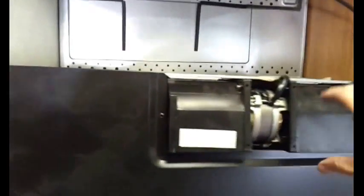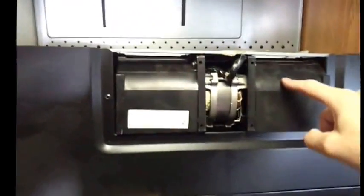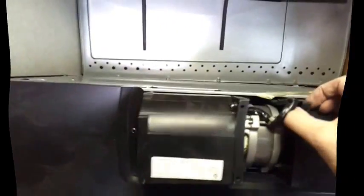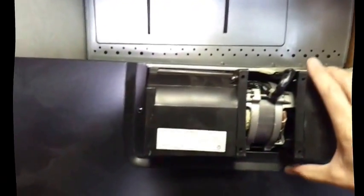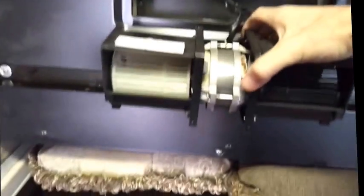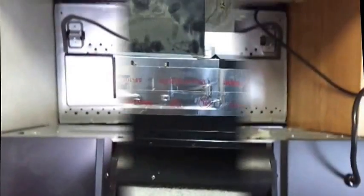Okay, we got it figured out. So from the factory, they had the blower motor installed in this direction — it was blowing air to the front. I want it to blow outside to the vent, to suck all the motor exhaust out of the RV. To remedy this, it's pretty easy: pull it out, rotate it, and stick it in this way. Now it will blow the air out the back. So I'll try to get this thing back together.